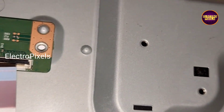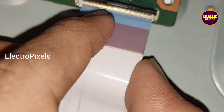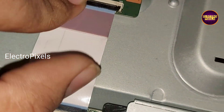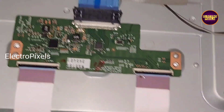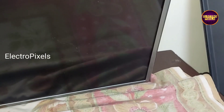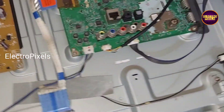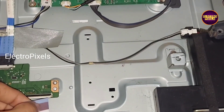See friends, here I fixed the FFC cable. Now let us turn on the TV and check the picture. See friends, after removing the gate signals from the right side also, the complaint remains the same - it now becomes no picture. So this means that in this panel both left side and right side gate signals are short.